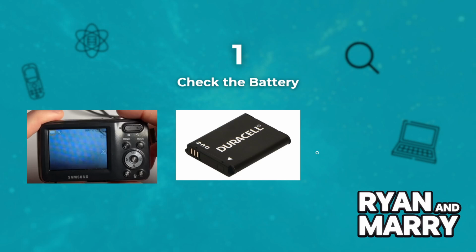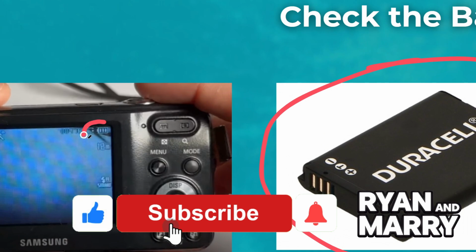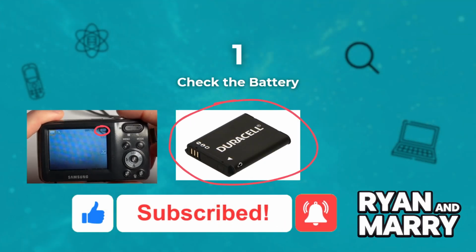Check the battery. Remove the battery and inspect it for any signs of damage. Ensure the battery is fully charged using the original charger. If possible, test with a new battery.